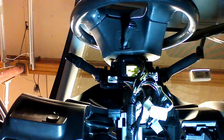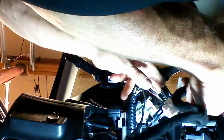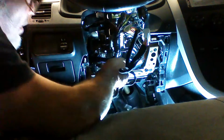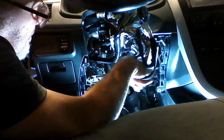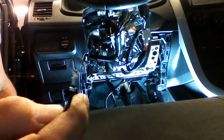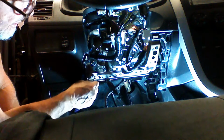In the previous steps, we unplugged our ignition switch, so we're going to plug our ignition switch plug that we unplugged previously into our T-harness. And then we're going to plug the T-harness ignition plug into the vehicle's ignition plug port. So we're going to route our harness behind the support bar here, and we're going to apply our system ground. We have a black wire with a ground ring. We're going to ground the ring right here.